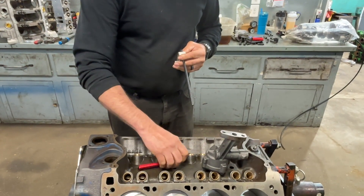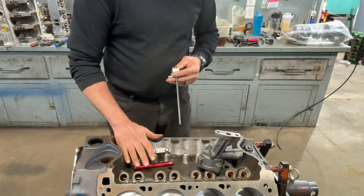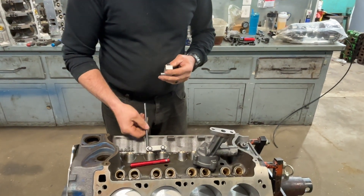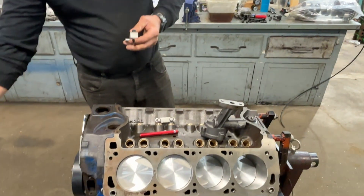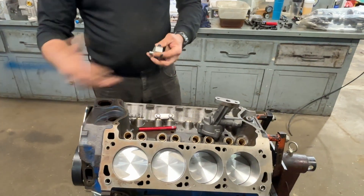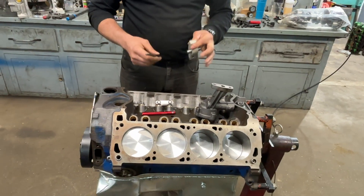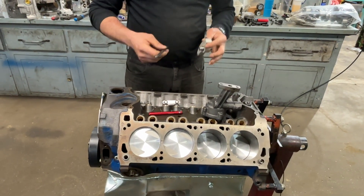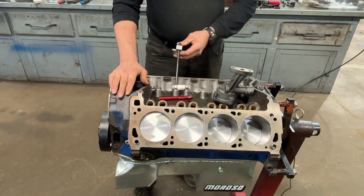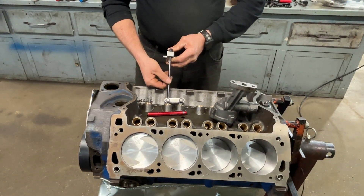So if you go the route of not fixing the lifter and the problem of the lifter, the next idea is: I'm going to restrict the oil coming out of the lifter. Again, same theory as trying to restrict oil to a cam bearing — you haven't fixed the leak ahead of time, you're trying to fix the leak after the problem. You're squeezing down what's happened after the lifter, after it was already supposed to have been metered, and now you're squeezing it down further. That works okay until you put valve lash in here.